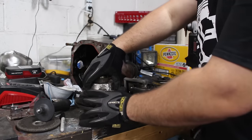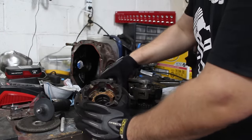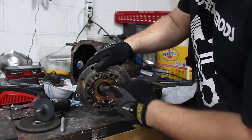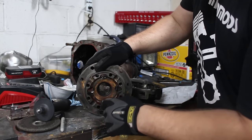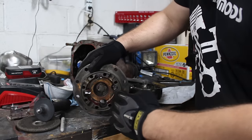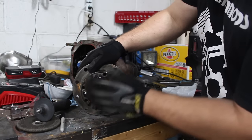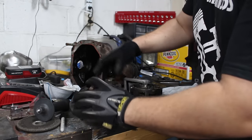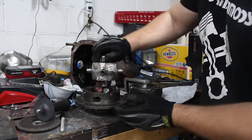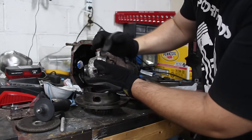I probably should have realized this before I did so much welding, but yes, there's a little rust in here. I'll clean it up. But you can see how these, I guess it's a bearing for the spider gears, kind of concave in. It's not just straight down. So the inside of here is kind of coned in, and I basically made this completely square, which wasn't able to fit. But if you can kind of see, I did taper off on both sides.